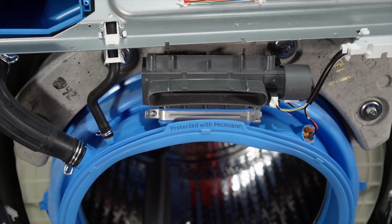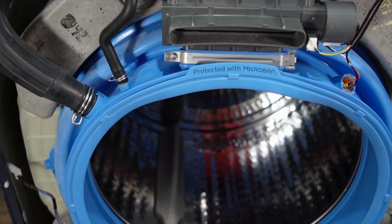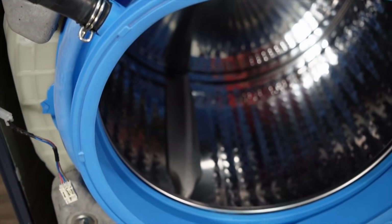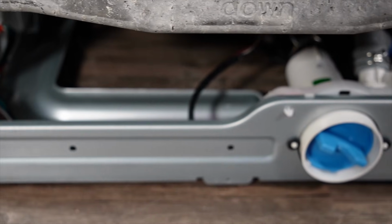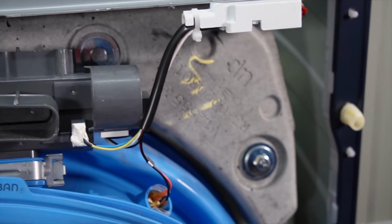One thing to remember though, if the board was possibly the culprit, is looking for any other damaged wires, which I kind of overlooked because I knew that the board was bad on this particular machine. Make sure to check any wires that are underneath, like the motor and inverter assembly wires, for any damage or breaks. You could also have issues with the door light or dampener system.